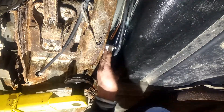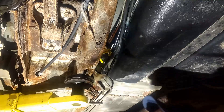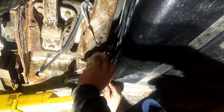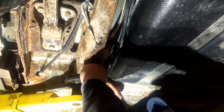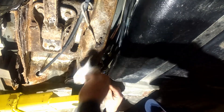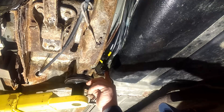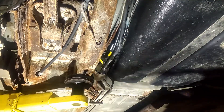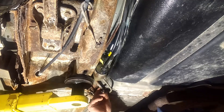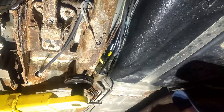So I just spent the morning doing my new intro, which I think is pretty cool. I also helped a guy out — he got most of his brakes put in on his truck, just needed the right rear. I put some brake pads in and he told me he didn't put the clip on the other side, so we took that apart and put the clip in. After this one I've got another brake job to do. I think this car needs a new fuel filter, but I'm not too worried about that right now — we almost have to move it a little to get to this line. There's some brackets up there; that's usually where they leak.